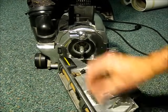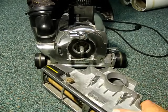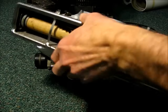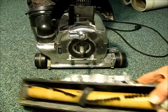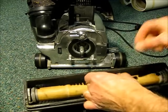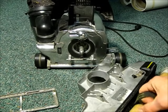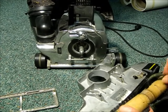The next thing we're going to do is release these two levers here — these hold the floor bottom piece that rubs against the floor. Now we're at the brush. Just use the belt unless your belt's broken. Give it a good yank and out it comes. Then you would take the old belt off and put a new one on.